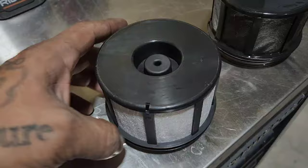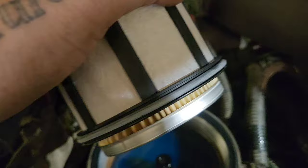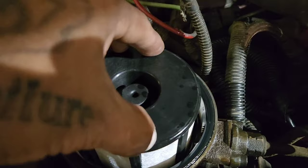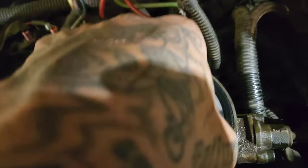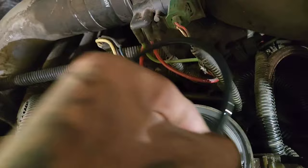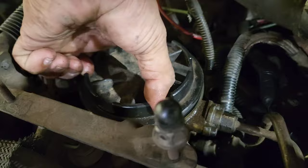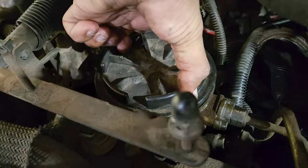This is usually going to make a mess, so put that right there. Usually that's the hardest part — getting the wrapper off. This is what the filter should look like. This filter has never been changed, so it's a good thing we're changing it now. I put the new seal on this one all around in the little area provided. There's a rubber grommet on it, so you kind of have to push it in and make sure it seats properly. There's also another little ring here — we've got a new one of those too. We'll replace the filter cover, and when it gets to the bottom we'll use the screwdriver to make sure it's tight again.